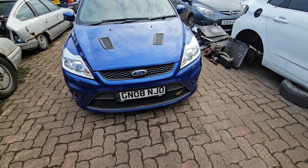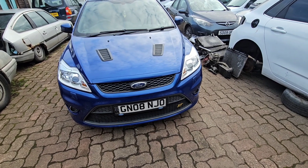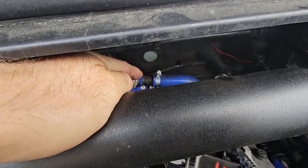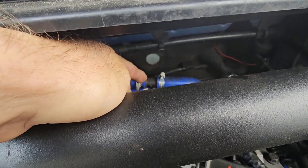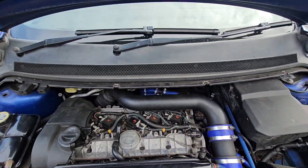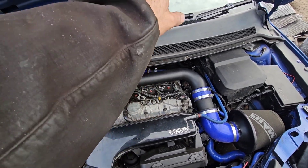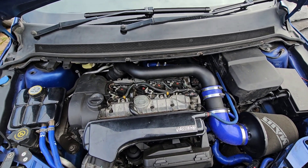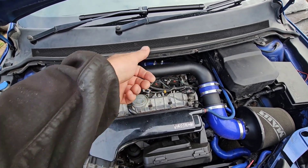I also did a water test because I was losing a bit of water. This water hose here - the plastic connector pipe, the one that was originally in there on this side - was all broken inside so it was leaking. It needed pressure to make the water squirt out. We put the pressure test on it, pumped it up, and it was coming out like a fountain - you could just see a fine spray. I was thinking something was wrong with the engine but it was just that - it was all broken and brittle. Someone must have done it really tight and just cracked it. So that water leak should be fixed now.